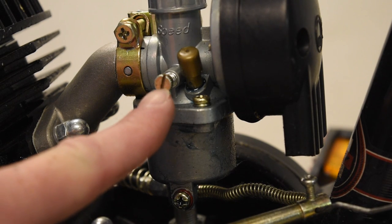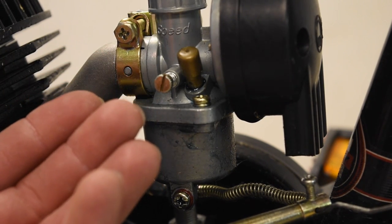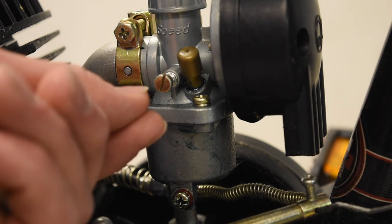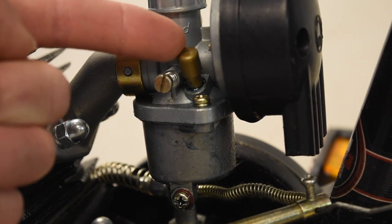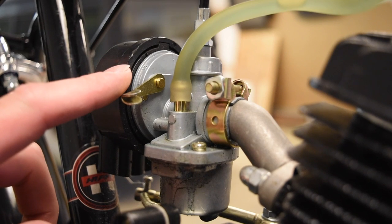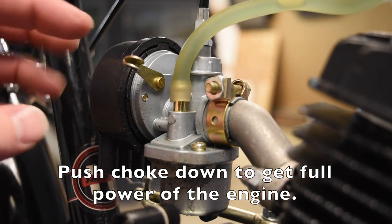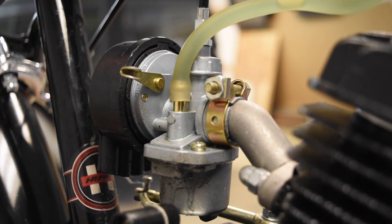Right on the side of the carburetor is this little screw used for when you're idling. If you're sitting around with the engine running and it's running kind of rough, turn it clockwise and it will give the engine a little more gas and hopefully smooth it out. If your engine is running way too fast, turn it counter-clockwise and it will slow the engine down — and that is only when the bike is sitting idle. This right here is a little primer. If you're starting the bike for the first day, give it a couple of pumps and it will put some gas into the little chamber on the bottom and help the engine start up. On this side of the carburetor is the choke. When starting the bike for the first time in the morning, I push this up maybe a half inch — that's been a good way to start the engine. Once the engine starts running, you can put it back down all the way.